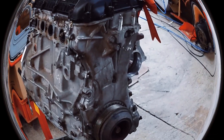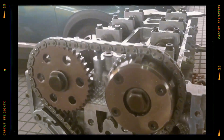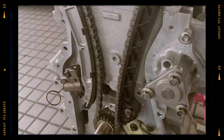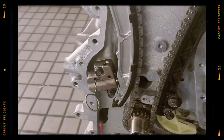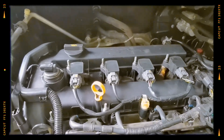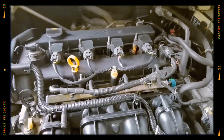The variable induction system's moving parts can become stuck, leading to reduced performance or decreased fuel economy. After 200,000–250,000 kilometres the timing chain may stretch, and prompt replacement prevents more serious engine damage. Because the engine lacks hydraulic lifters, valve clearances should be adjusted approximately every 100,000 kilometres.